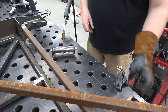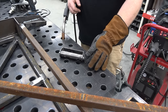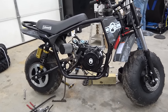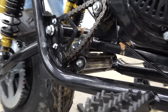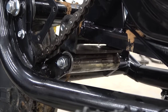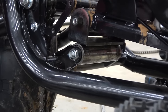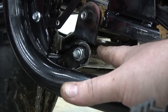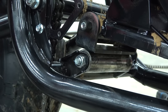There it be. Now we can unbolt this off, bolt this where the swing arm was, bolt this new thing to where the swing arm is, and then come up with our cradle. So with this new stance, we have the engine riser installed, if you can see that. It worked out, that little tower I built sits right on that machined piece. So I can weld this all the way to this. It's as simple as that. And then I can take this out and make a jig to be able to build these on the table.